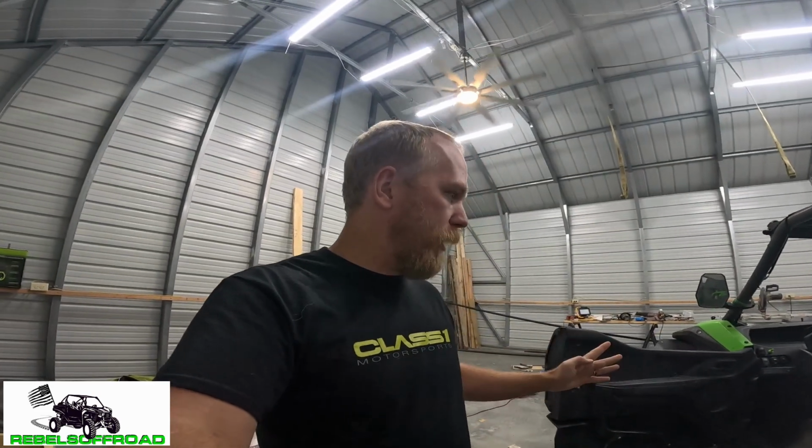So I'm gonna run a circuit and I'm gonna show you what circuit it's gonna be using. A lot of the blinker kits do run on a positive light, so you might wanna check that before you go to the trouble of running that circuit if you have already a street legal kit on it.